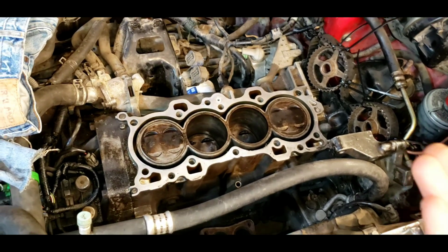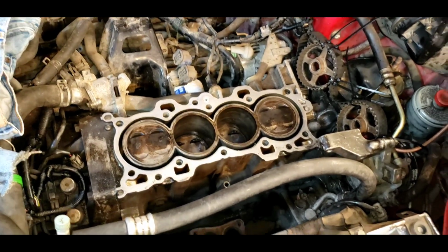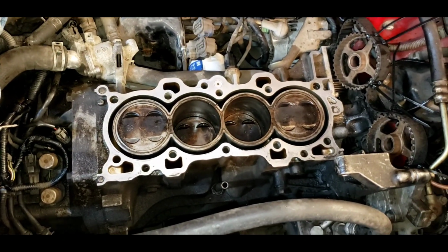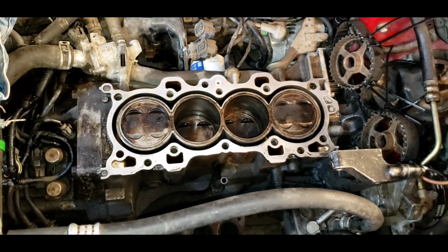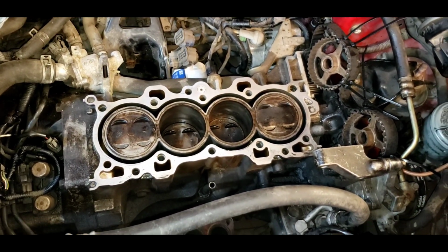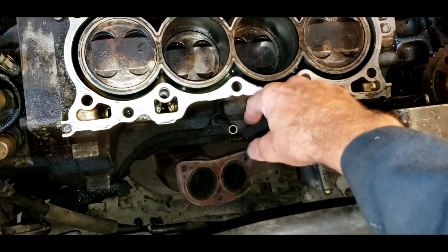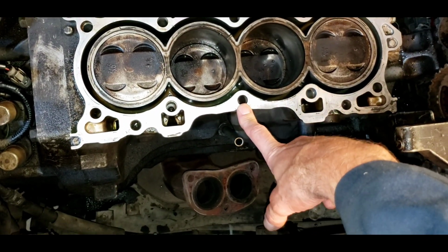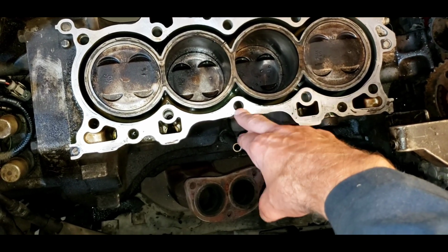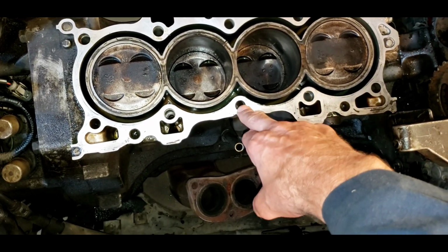And I got it sort of tight. I thought it was good. It wasn't good. So doing it all over again. It's on me. It's just the way it goes. So I got a better head gasket, not a non-Amazon one, a Felpro. And today we're going to clean this up. I blew out these holes, sucked out all the coolant from everywhere, and I'm going to tap and put a Time-Sert in this hole, and I'll show you what I mean.